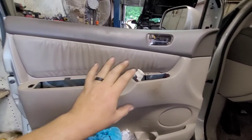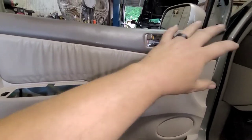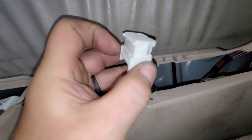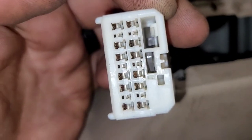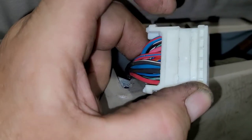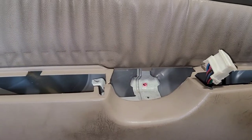Okay, so the panel is basically in place - it's snapped in place. Obviously I've got to clean it, but being a mechanic I wind up getting stuff dirty. Basically I've got to put the screws back in. This is actually kind of an interesting connector here - the outer shell, once you get this piece in, slides in. And in this area there in that hole, you can see that gray piece - that gray piece is a lock. And this outer portion, once you get this in place, can actually slide in and lock in place to hold it to the switch.